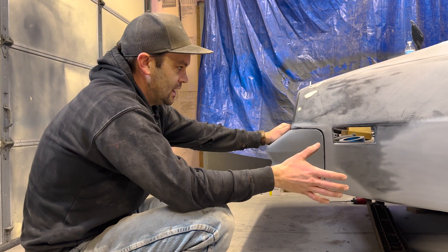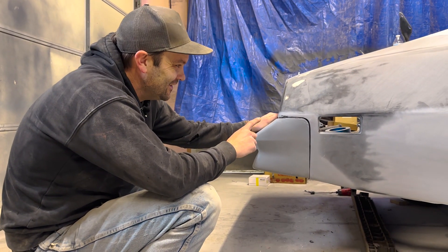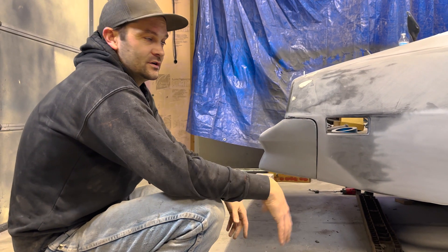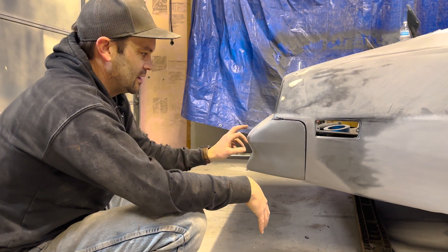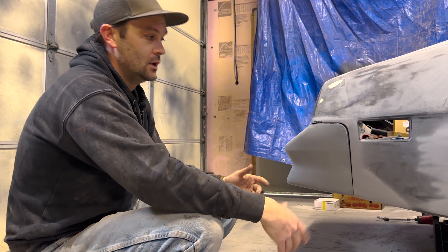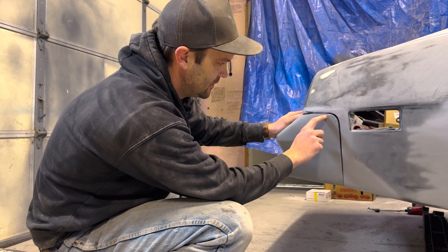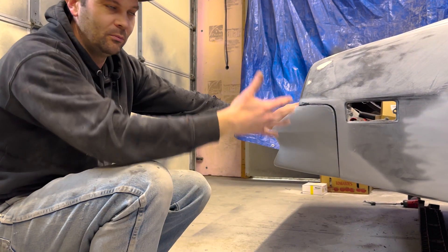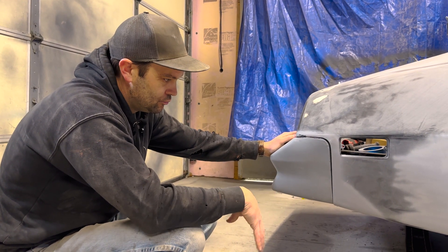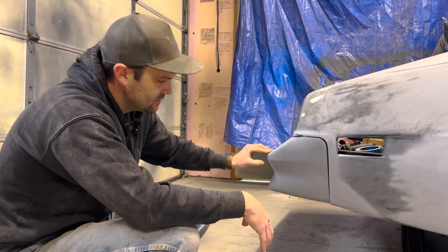One thing with these — and it's not just the fiberglass, this is a good fiberglass product — any of these, you get a whole quarter panel, it gets pressed thousands of times making these things, and over time you're going to have some tolerances, some things are going to be different. Same goes here: they put these into a mold, and over time popping pieces out, that mold is going to flex so you'll get some discrepancies. Overall not bad — gaps are pretty good up here, a little thick here, we'll have to build up with some fiberglass and cut a little bit, but overall don't buy these thinking you'll just throw them on, there's going to be some work involved. It's a pretty good thing to start with — solid, not flexing around at all.